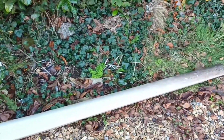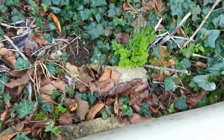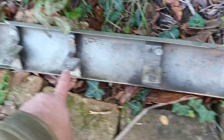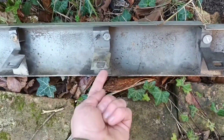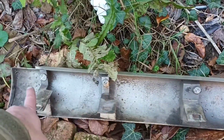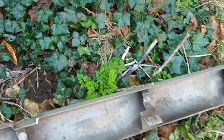Okay, so I've just taken the sill cover off, which is a bit awkward to film while I was doing it. Obviously I just have to hold the camera with one hand, but basically all of these have trim clips up inside them, which come up through here and up into the underside of the sill. So that's 9 clips in total. And then these ones go into the side of the sill. So I've ordered some more. There's a couple of casualties, look. So we'll replace them. It's also been off before, not been particularly put on very well.